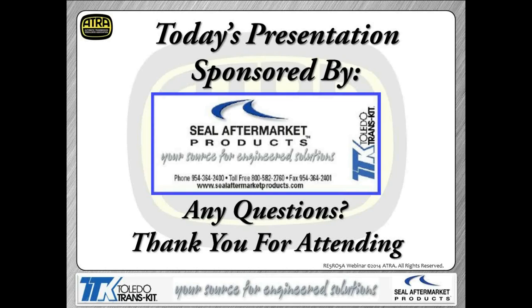What you'll find in the first design up to 04 is 4 screens like this. After 2004 and up, there's 5 screens altogether. What we want to make sure of is that the screen's open end is facing up towards the valve body. And this is obviously the same for all the valve bodies.